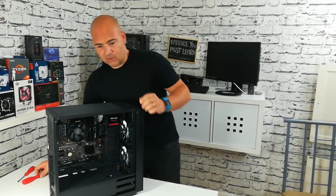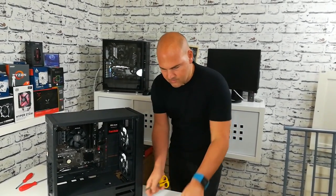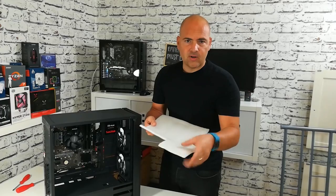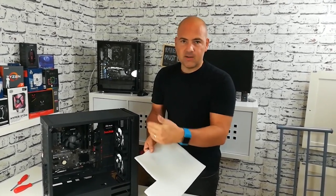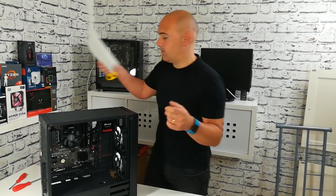So what I've done — using some packing foam, I've cut out some pieces roughly the same size as the hard drive, 3.5 inch. Two of those on top of each other to give it a bed to raise it up off the deck, another little piece at the front of the drive, and another little piece on the side of the drive, just to isolate any mechanical vibration from the chassis.